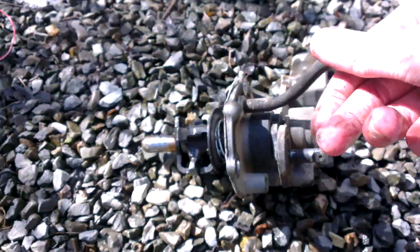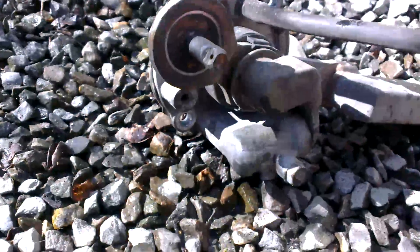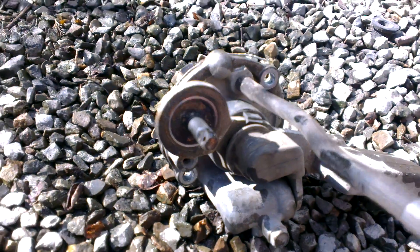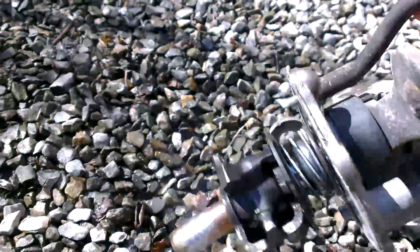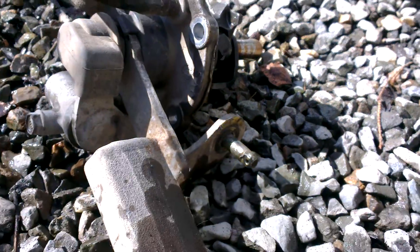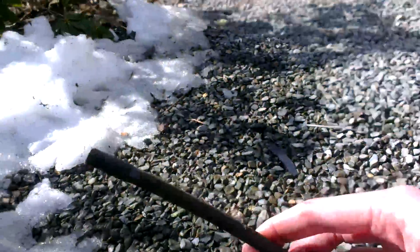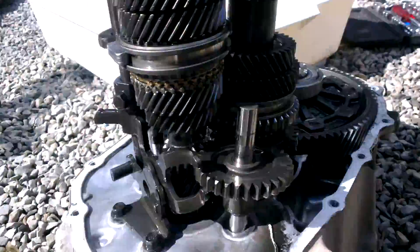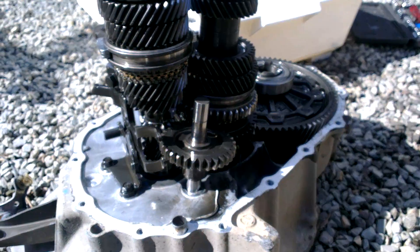That's the selector mechanism here, which went into the gearbox. As you can see, there is one part here — these are the sockets that the selector push-pull rods go onto, that come out of the gear lever. On the other side, just here, that is where one of the other rods go onto. And that is simply the breather pipe, which will stop pressure build-up from the spinning of the gears. I'll dismantle this gearbox some more and I'll make another video. Thanks for watching.